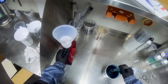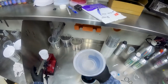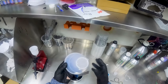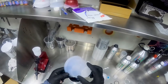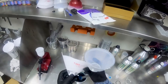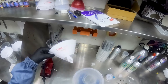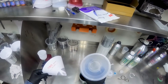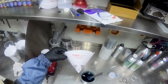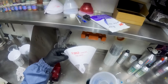Now, you'll notice on the spray gun here, I've got one of these different filters. I've spoken about these on my channel multiple times, but I know I've got quite a few new people on my channel as of late, so I'll just give you a quick rundown. The difference between, say, a 190 micron fine mesh filter and a candy filter. If I was to pour the candy through this filter, it wouldn't really get filtered. That's the whole idea of using these.